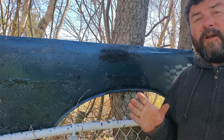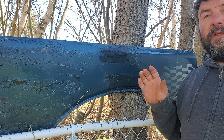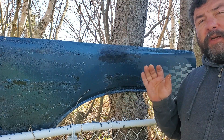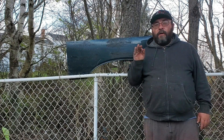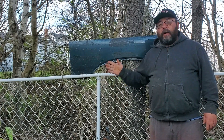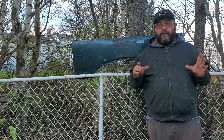The keys to success are: start small, work a square foot at a time, clean it up. Aircraft stripper is the least intrusive way to remove paint from a vehicle — you won't distort or damage any of your panels. Depending on how many coats, you might have to go extra layers. The most important thing to know when you're putting this stuff on is: do not reapply it. Put it on with a roller, go in one direction. Put it on with a brush, go in one direction. Put it on with a spray bomb, make sure you cover it, and you'll be good to go. Start out with one square foot at a time until you get comfortable enough to do a bigger area, and you'll be set.